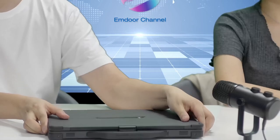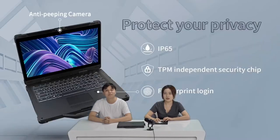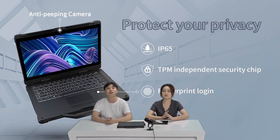Yes. So next one, as I understand, the Exodus 3 has the IP65 protection level, and we have mentioned the fan and the openings just now. So with these components, the laptop can pass all the sealing requirements at this level, right? The Exodus 3 fan sits in a separate sealed compartment, and its two openings are sealed through a very slender tongue and groove design. No liquid or gas gets inside the electronics part of the laptop, and as for the physical ports we mentioned, they are covered by the protective covers. Yes, all of these designs keep it in line with the IP65 protection standards.